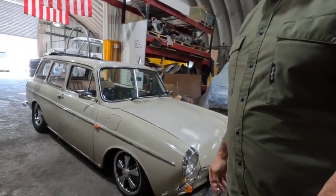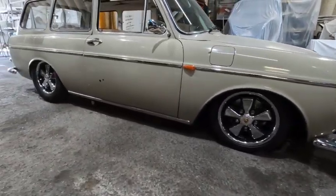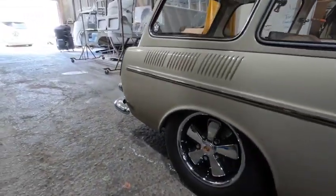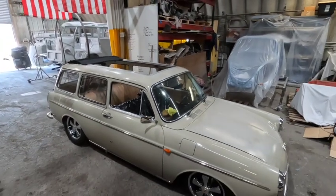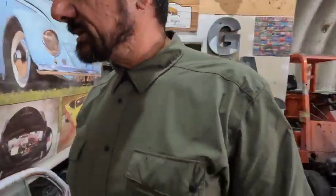We got Rodney's car done - I think it looks pretty killer with a great stance to it. Truth be told, I've got to rip into those drop plates again - it's too low. They're adjustable and that's almost all the way up. Why have them adjustable if slammed is all the way up? We got to raise it - we'll be redoing it. When I do something like that I do it on my dime, my time. We did a double drop - the drop plate added an actual drop in the plate itself, and the car was already lowered, so I under-compensated for how much drop the plates were allowing.